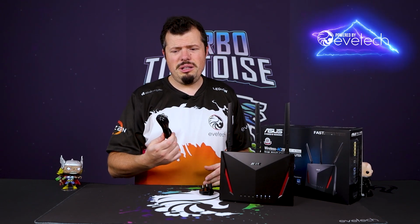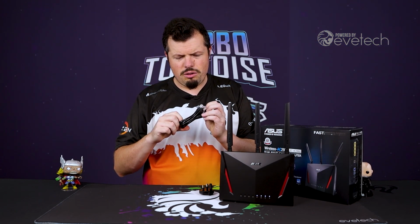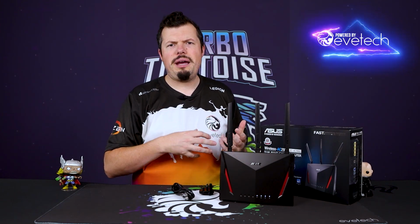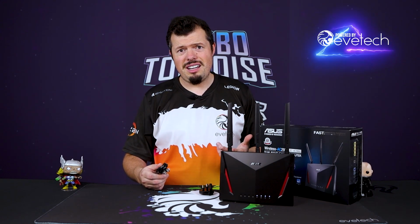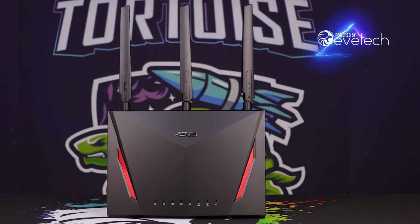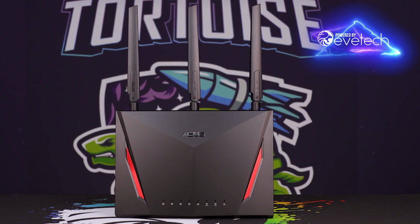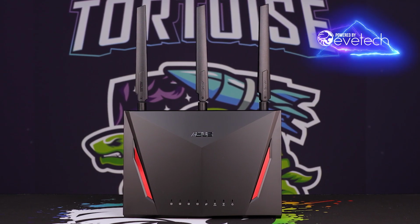You've seen how good the graphical user interface is inside of the router. These are absolutely fantastic. Nice included kit. I mean, you even get a proper little piece of Cat 6 over here, or it's Cat 5e, but it's really good quality, nicely molded cable even. You know, by default they put in patch cables, most of them have only got 2 twisted pairs actually inside. This is a full 8 wires, so it's a full 4 twisted pairs. It's just better. Everything is just nicer. The aerials are better, the build quality is better, the ease of use, solid 10 out of 10.